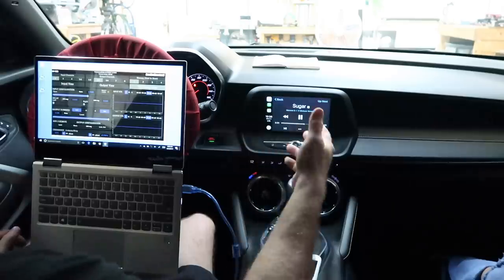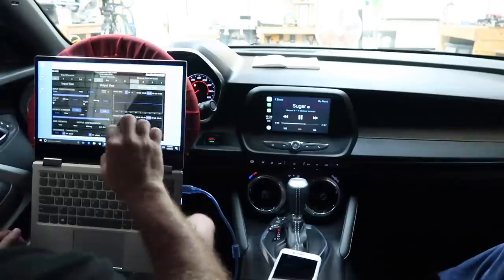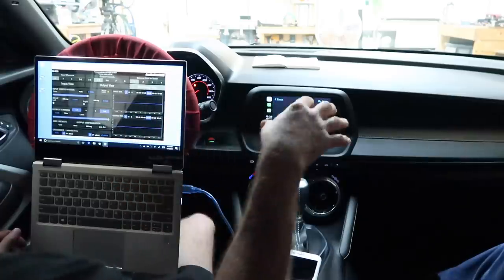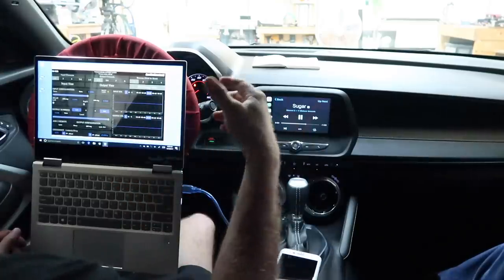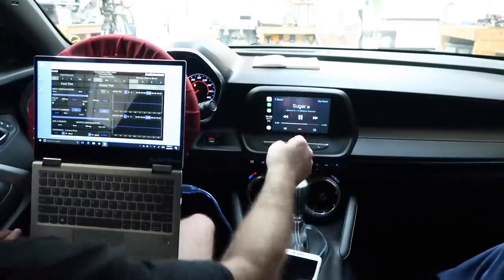We've turned the subwoofer all the way down. Now what we want to do is just go ahead and listen to it, and we have the auto EQ set up. So we have a basic EQ setting. In a minute we'll bring in an RTA and see what it looks like. I just want to hear the bottom end coming out of these midrange drivers to see if we need to bump up the crossover point any.